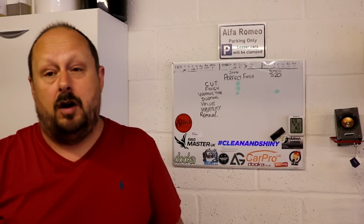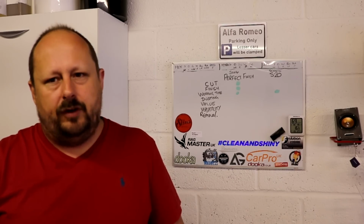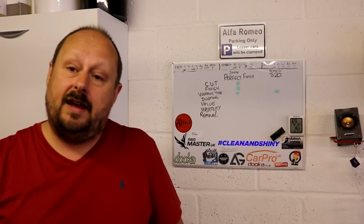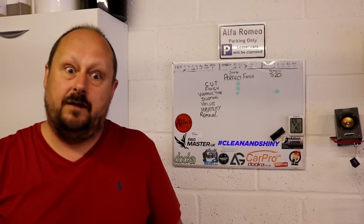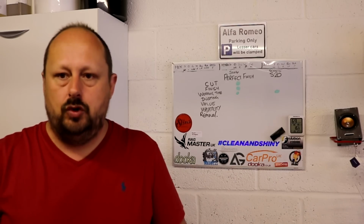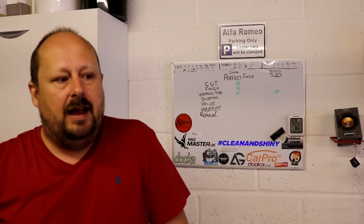Both these products talk about low dusting formulas, and both of them deliver on it. They deliver on it in slightly different ways. As I'm working the Sonax Perfect Finish, it's a lot lighter and more translucent. And when you go through that cutting phase into the finishing phase, you're actually seeing the gloss come up under the abrasive, which is unusual to see. So it's got a very clear carrier in it, this particular product, very clever carrier.